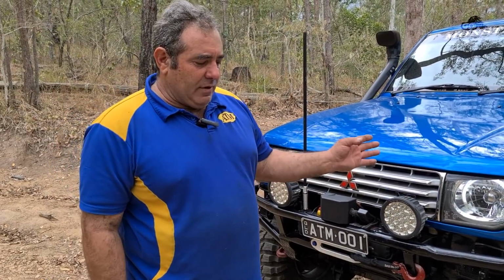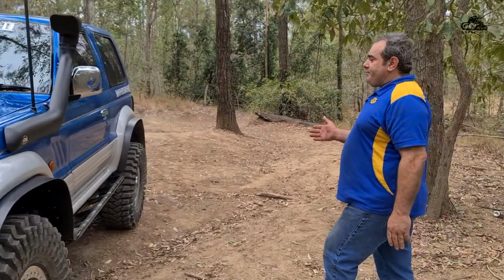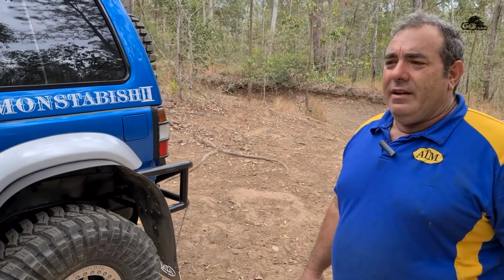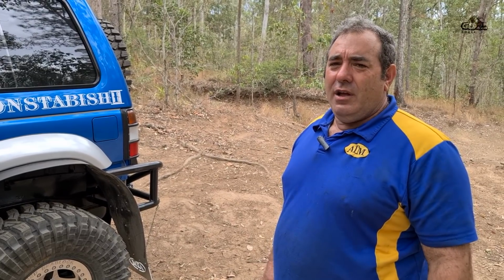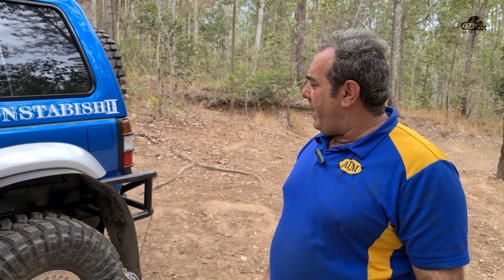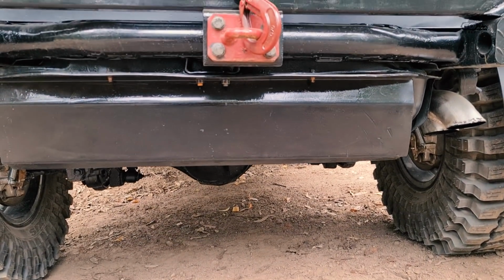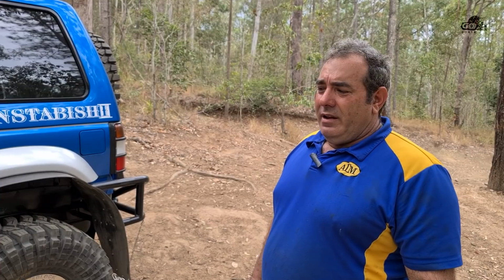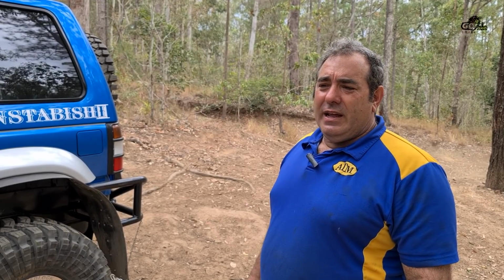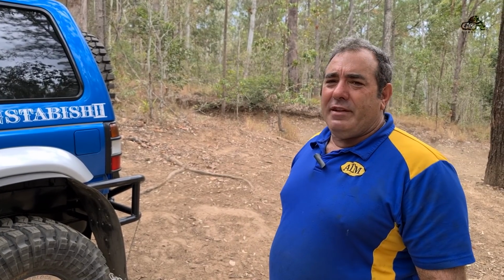In the rear, I have a standard petrol tank, and inside that standard petrol tank I've used a Falcon turbocharged fuel pump, which bolted straight in place, made itself very handy. And to protect the tank itself, I'm running the 3mm bash plate, which came off Monster 1. Now Monster 1 was a long wheelbase, it had a 92 litre fuel tank, and this one's only 75. It has the same profile, but shorter. So I just rebent it and remounted it.